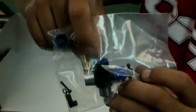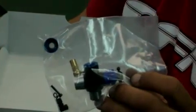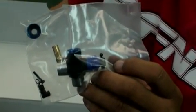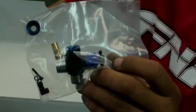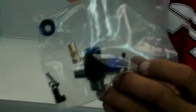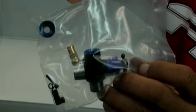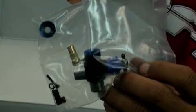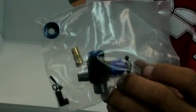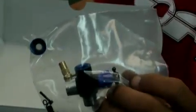Installed already is a 7mm carb Venturi vent, but also on the side of the package is a 6mm. We have not offered the 6mm Venturi before, so now it comes in the system. If you want the optional 8mm, we will also offer that as a separate part number. The detail on the carburetor is blue to go with the Pico head itself. This is already custom to the JPX 21 Plus carburetor. The JPX 21 Plus only has the 7mm carb, but you'll be able to get the 6mm from this Pico to fit it in there too.